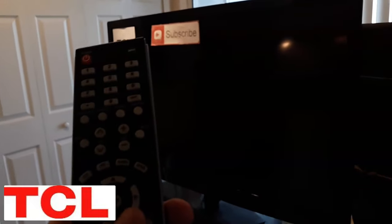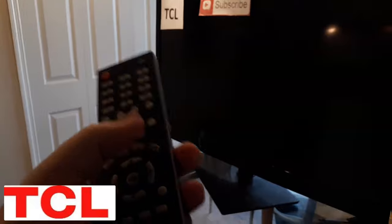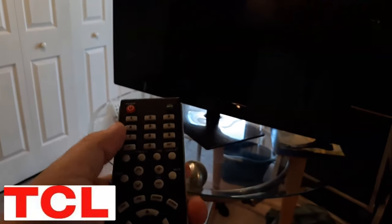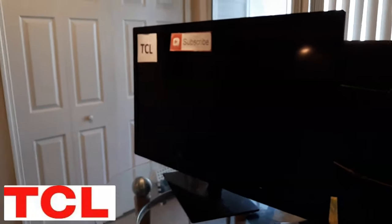On your remote, look for either the menu button or the settings button. If you have a red light on the bottom or you can hear the TV, try hitting the menu or settings button and turn it on and off several times to see if the menu appears. If the menu does pop up, you know there's nothing wrong internally — navigate to brightness and increase it, as someone may have accidentally set a very dim picture.